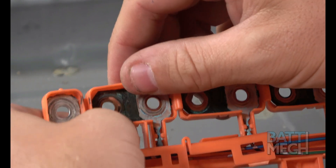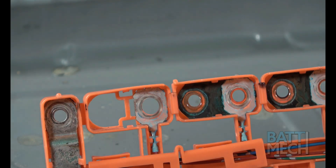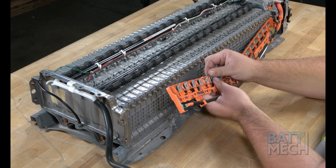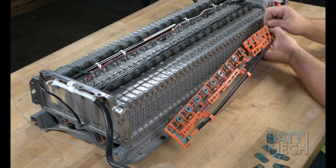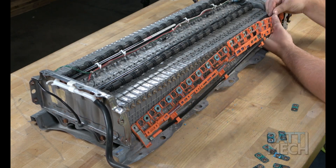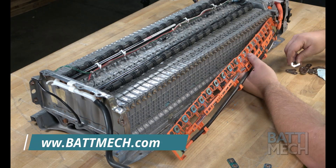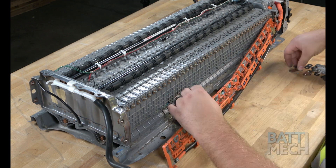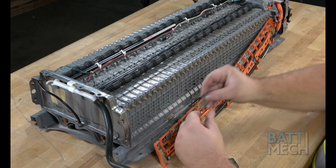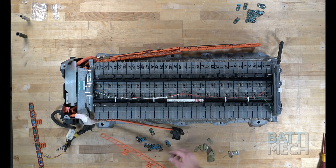The next step is to replace all your old corroded bus bars. BATMEC has supplied new bus bars with your battery pack purchase. The bus bars are located within the orange wiring harnesses. This step is critical to ensure that the battery will work at peak performance and to ensure the battery won't fail due to corrosion on the bus bars. Be sure to take extra precaution not to break a terminal when removing or replacing bus bars. If you happen to break a terminal, BATMEC.com sells replacement wiring harnesses for this model battery. This is a good time to remind you to save the old bus bars to return them to BATMEC to avoid voiding your warranty.